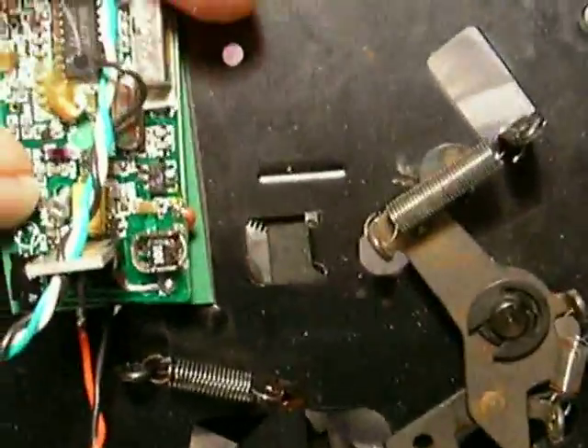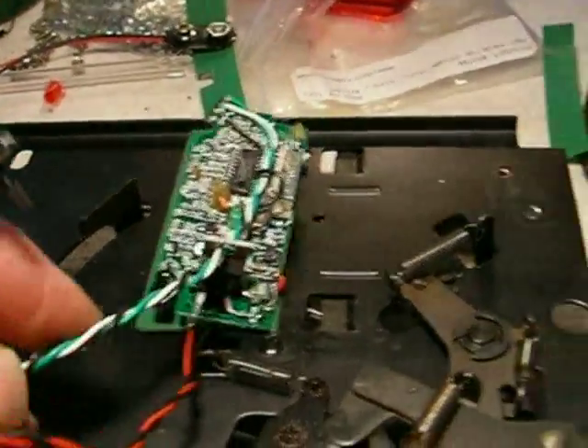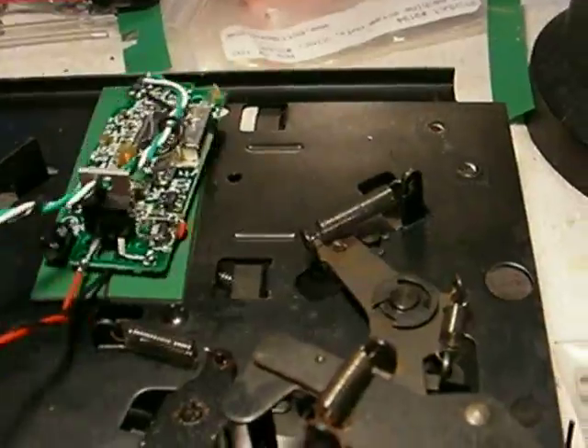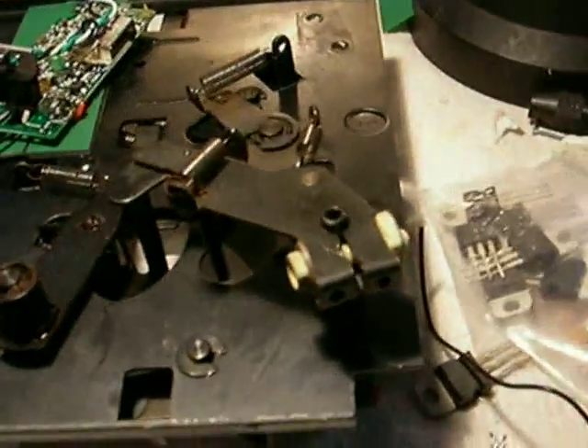You have your speed control here on the motor. The motor has its own regulator, so that does not need an external regulator. That's the whole FM stereo kit. I haven't soldered the antenna wire onto this little tab right here yet — just keeping it out of the way. When you put all these wires together, make sure they're out of the way of the mechanics of the turntable. That's why I put it through the hole here — it gives it a standoff and keeps it away from the star wheel.